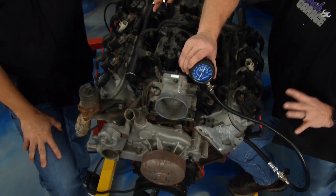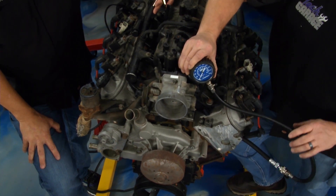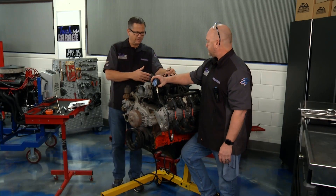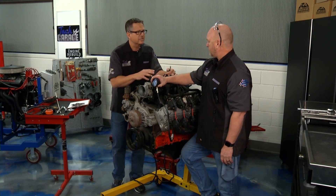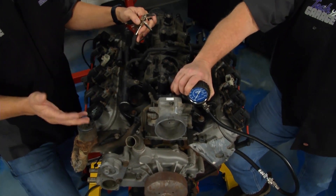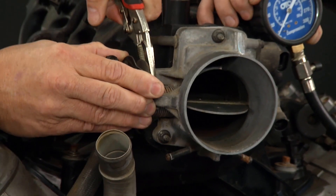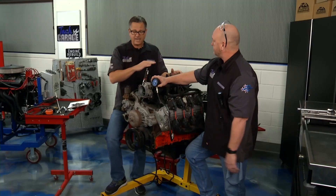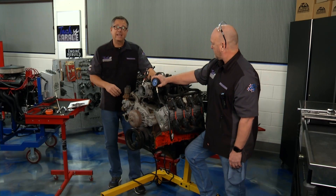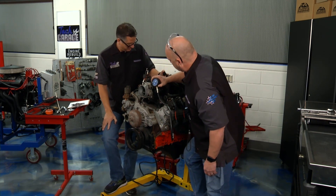I'm all set up for our first compression check. We need to do that in all eight cylinders, but let's see what we've got in one just for fun. A compression test — you can do it out in the junkyard, it doesn't matter. It tells us the condition of your engine. We hooked up a jump pack to the starter. To do that, you want the engine warm, block the throttle wide open so you get full airflow, and have all the spark plugs out for even cranking. Watch the gauge through four compression cycles.